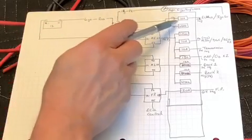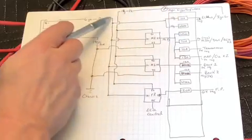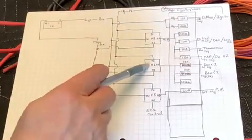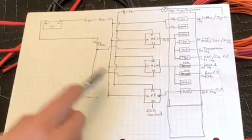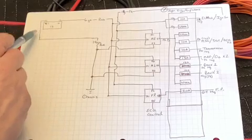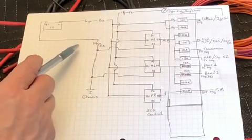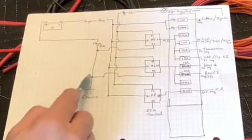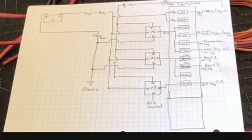It comes down, it feeds our first 2 circuits. One's 10 amp, the other is a spare. Then it comes down and feeds main relay 1 and main relay 2. Additionally, it feeds the fuel pump relay, and from there we'll have control of the fuel pump. The ground side is a 14-gauge black wire, and that's really overkill. It could be 18 gauge even. So then the ground goes over and feeds pin 85 off of our 2 main relays. Just for reference, pin 85 and 86 are interchangeable, it doesn't matter.